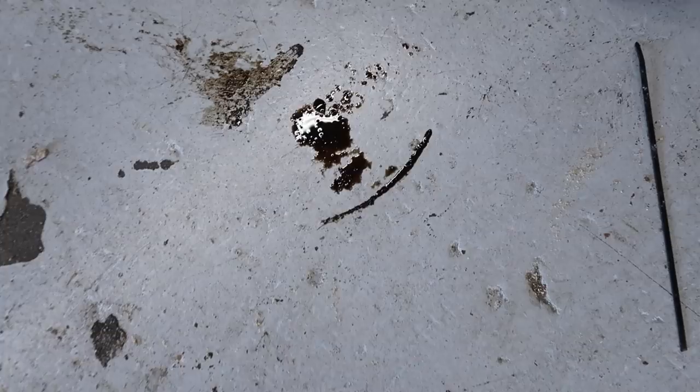Almost everything on the Suburban works. The issue is the front axle assembly. That whole front differential, the output bearings are all shot, and I'm sure something inside is also messed up, and that's why it's dripping fluid. I had a drain pan, and as soon as I pulled it out, it started leaking all the way out. So for the front diff, I found the whole assembly for like $250. We'll go pick that up tomorrow and replace it, and hopefully that's it. If that doesn't solve the issue completely, then we're also going to have to change the transfer case. And if the transfer case doesn't solve it, then it's the transmission.